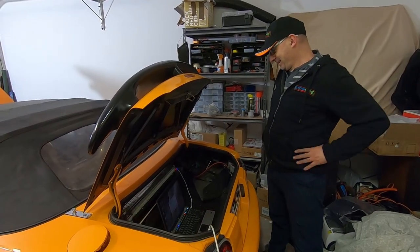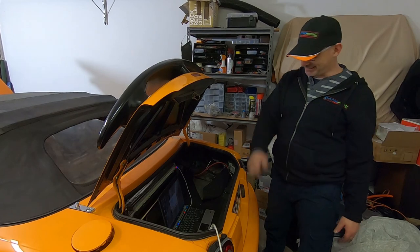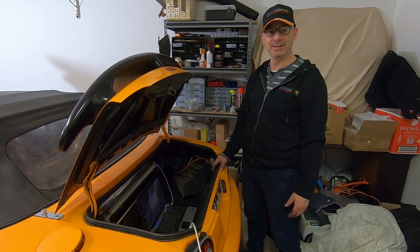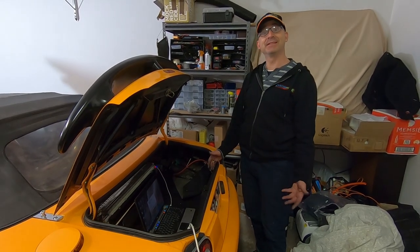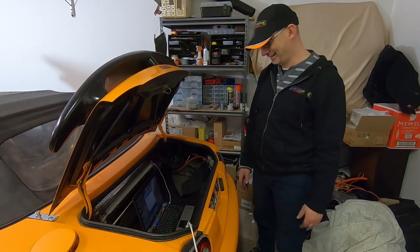So where are we at? Well, we've got 121 volts across all the batteries. So that's good. I'm just going to check the BMS to make sure that we've cabled that up correctly. And if all that goes to plan, we'll put in our trusty car battery, the 12 volt battery, so we can start the car. So click on the relays, like the starter motor, yeah.